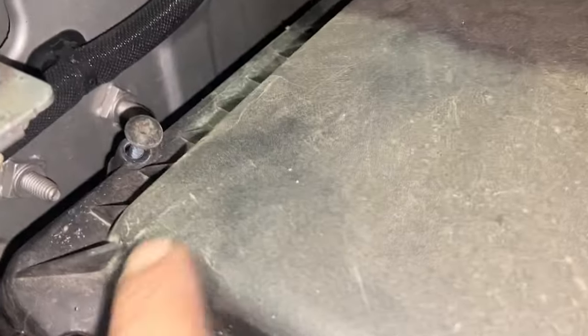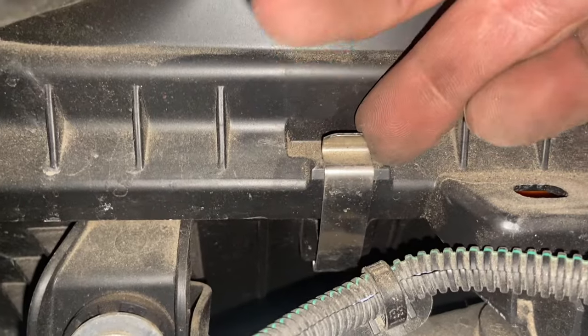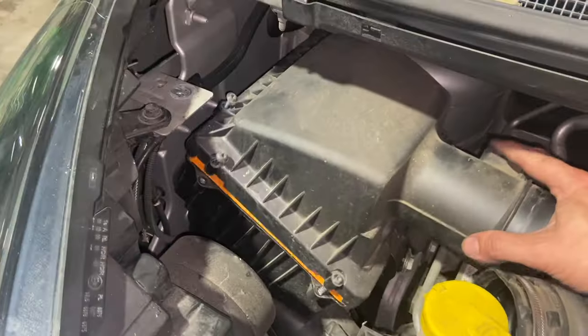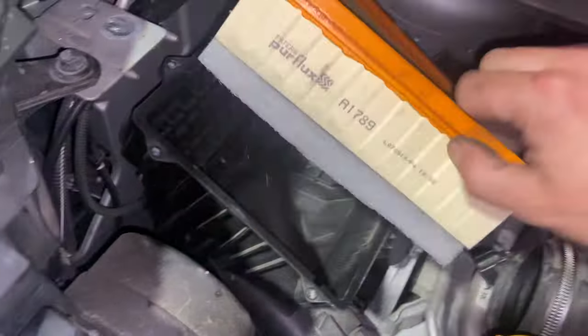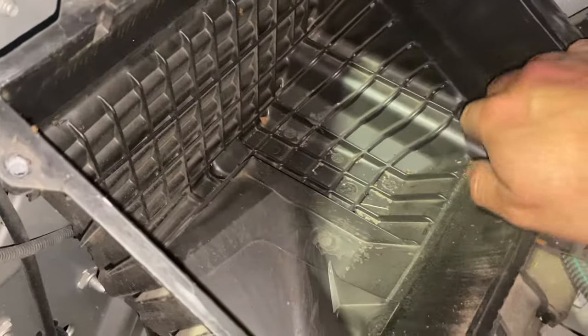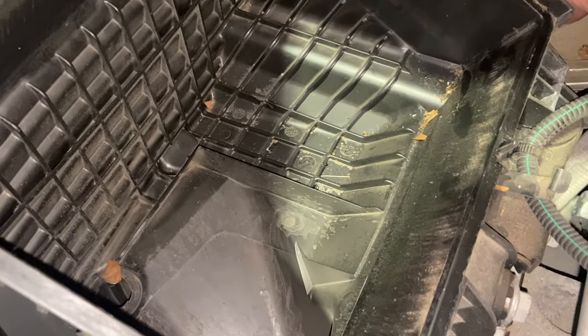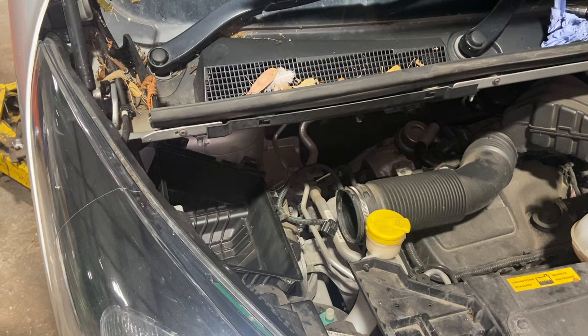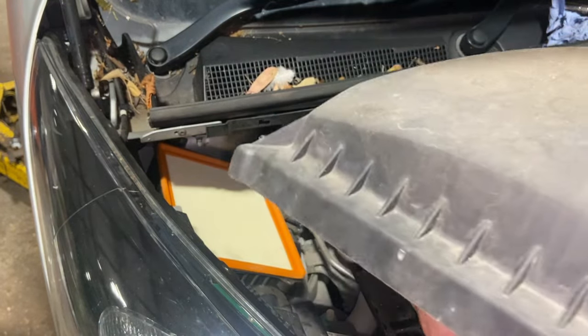Now that we've got the bracket out of the way, I'll show you there's another little torx at the back there — it's tucked underneath. It's just a little spring clip underneath there and you can simply flick that off and out of the way, and we'll be able to remove the lid. So we've done that — just simply take the filter out. You always want to have a quick look in the bottom of the filter housing. This one's pretty clean, but sometimes there's a lot of debris in there — you might want to hoover that out and give it a quick wipe. All we'll do now is get rid of the old filter, put the new one in, and put it back together. Just as you're putting the filter in, make sure it hooks in on these clips first and then clamps down.